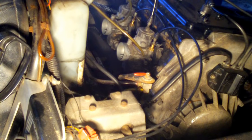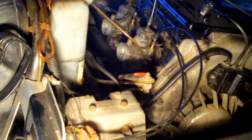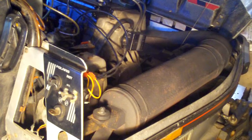I'm surprised the idle is as high as it is on two turns in. I've gone out half a turn on each one and started it up, and it still seems to be running a little bit faster than it should. That right there is pretty close to 2,000 RPM. If I adjust the idle screws back even just a little bit, it drops down and stutters around 1,500 and doesn't idle smooth. So I've turned them in just a pinch on each one and they're around 2,000 with a smooth idle. Clutch engagement isn't until somewhere between three and four thousand, so it's not going to accidentally go down the trail. I think we're done adjusting the carburetors on this 1988 488 Polaris Indy Trail. Good luck with your sled — download your shop manual for your year; it's a big help when you have questions about how things should be adjusted.